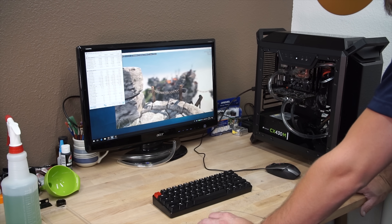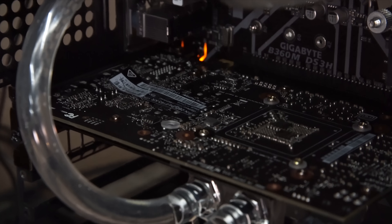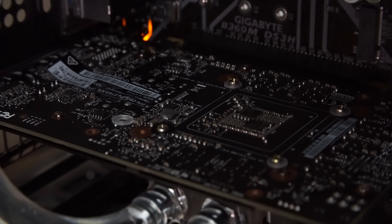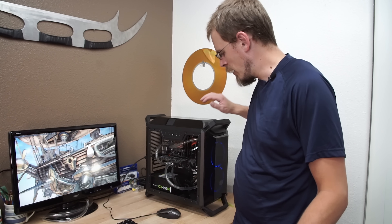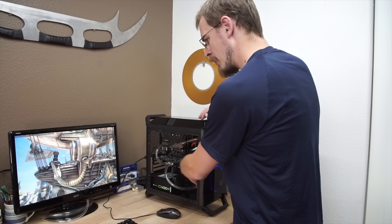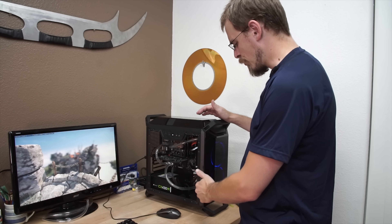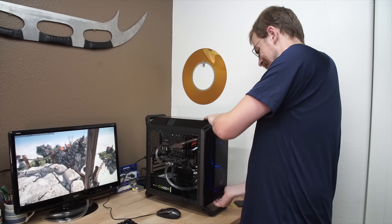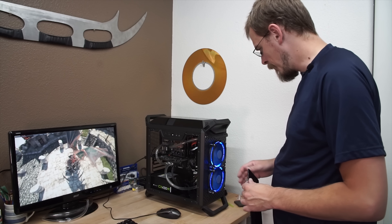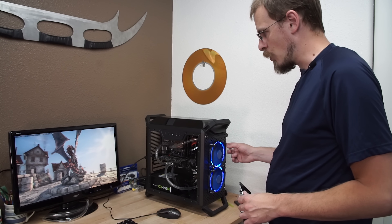Temperature-wise, it is certainly performing: 38 degrees on the CPU and 38 degrees on the GPU. This just happened — you see the nylon washer sitting on top of the video card? It's supposed to go under the video card screw, and it just literally jumped up on me. So thus far this kit in my mind is kind of a fail. There are no leaks happening, but our GPU just hit 62 degrees Celsius, so we are starting to match our air cooling temps for the GPU. My theory is there's just not enough air making it through this radiator. This is a fairly thin, dense radiator and these fans don't seem very high pressure. There's a grate in between the fans and the radiator itself, and I think these are just not very effective. We just jumped up another degree to 63. I think I might try swapping out these fans, and in fact the fans themselves are getting hot, probably from that radiator.